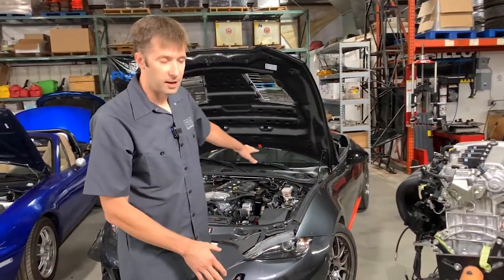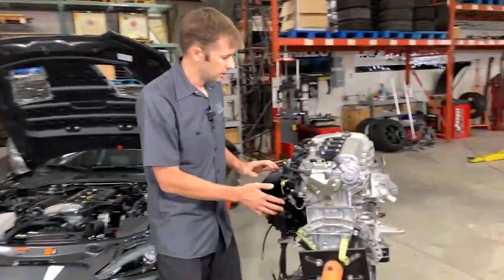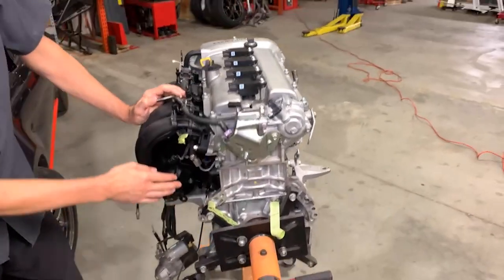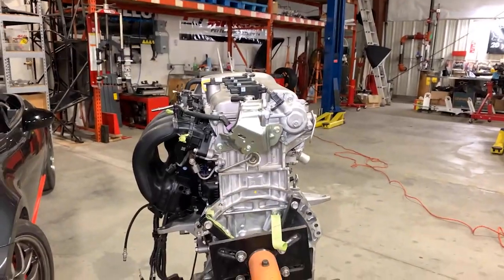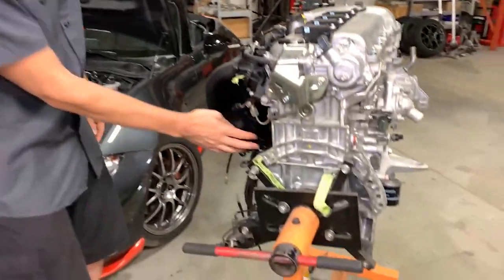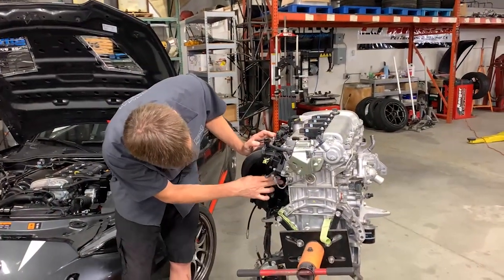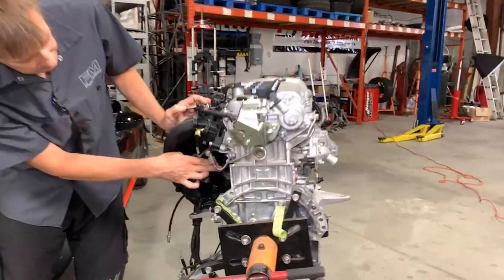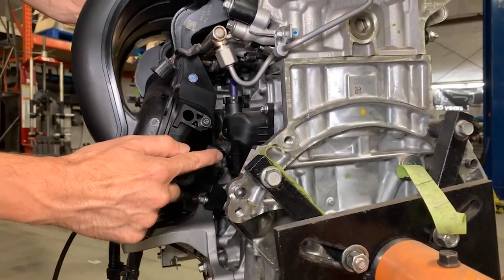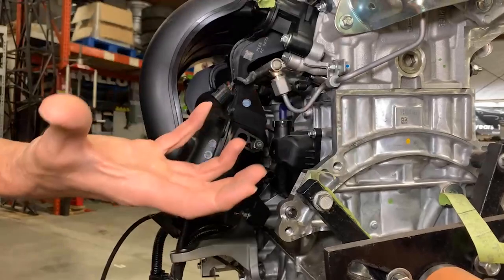On the ND, I said it goes to the valve cover, but it doesn't — it goes to the crankcase. The topside goes to the valve cover, easy. But those hoses just kind of disappear back in there. They go back here — this is the same concept as on the NA but it's down here. This is actually your PCV valve right here, and this is the intake half for the intake manifold. It's crankcase as opposed to valve cover, but it's all the same thing, all connected.